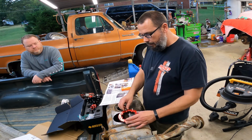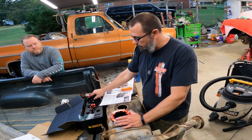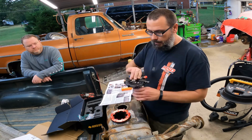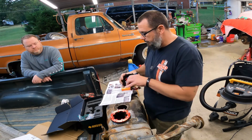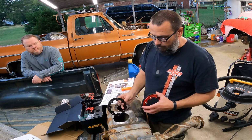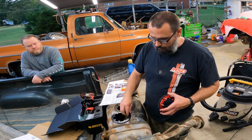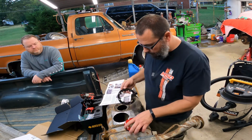And it says if you run both of them, then you can leave this mounted to the tank itself if you ever have to pull this out and change the pump. So you just unbolt it from here and it'll come off with this red ring. Doing it this way, I also do not have to drill any more holes into the tank itself.